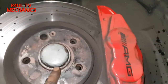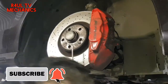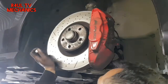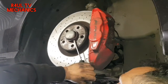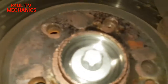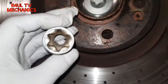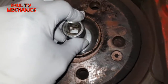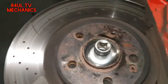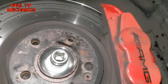We're going to go around to this side, flick that cap off — there should be a nut or something behind there. Get a little screwdriver or whatever you've got and just take that cap off. After you take the cap off, what we need is an E-24 Star Torx. Get it on there and whizz it off. You can jam something in the disc, or get somebody to press the brakes — main objective is to stop the disc, the rotor, from turning, and basically take the centre bolt off.